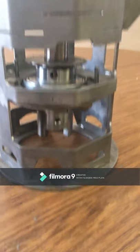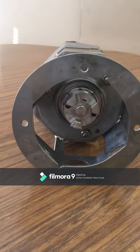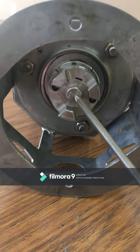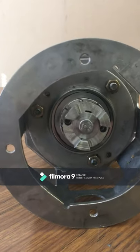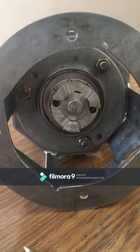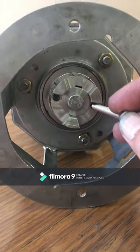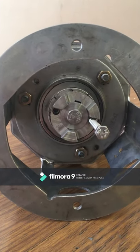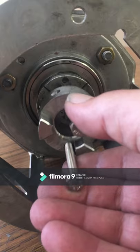The first part of the procedure when going to an oven and finding this kit is to remove the centre bolt and remove the grub screw from the side. That will expose two holes where you can use M6 jacking bolts to wind off the top half of the coupling. Wind these jacking bolts in and remove the coupling.